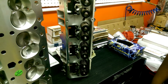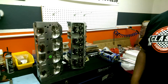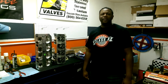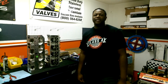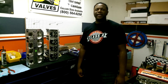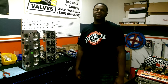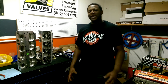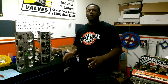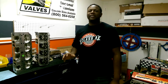The most commonly used engines we're going to talk about are the 350 and the 383. For the 350, the smallest runner you want to run is a 170 and the biggest is a 195. For the 383, the smallest runner you want to run is a 190 and the biggest is a 218. Staying between those two runners gives you excellent horsepower because you fill the cylinder a lot faster with really good exit velocity.